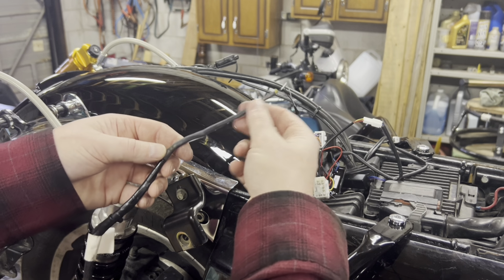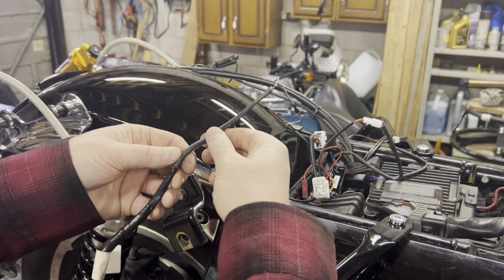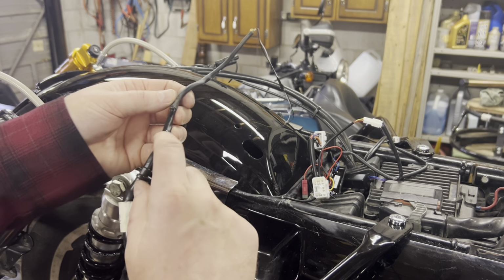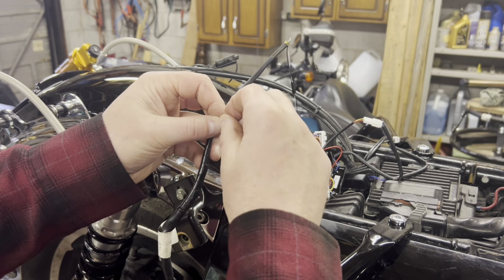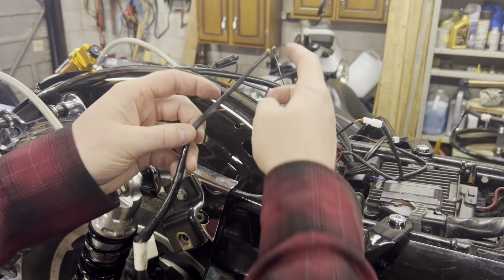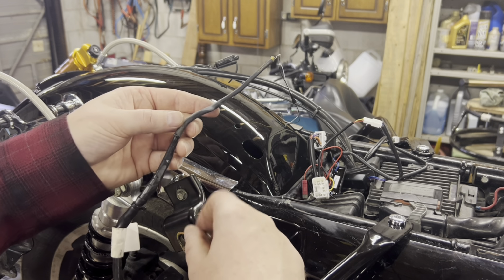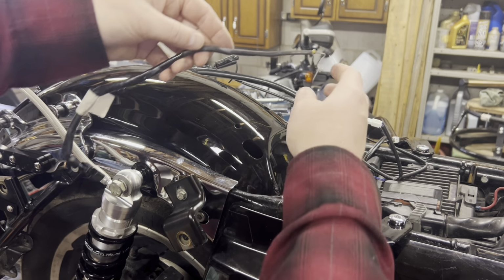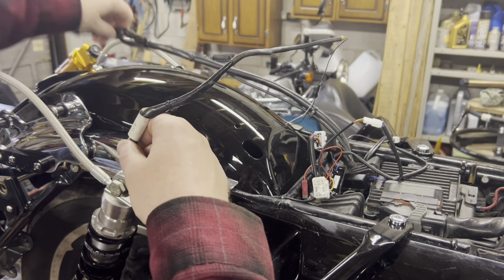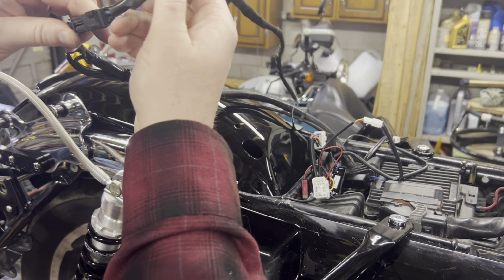Again, they're very thin. So those are aluminum wires. So I soldered them. But what I did was I twisted the OEM harness around the aluminum one, and then I straightened it and I soldered it, because the aluminum's now based in the center of the copper of the OEM lights. So now I'm just going to take our original police harness here and I'm gonna plug it in.